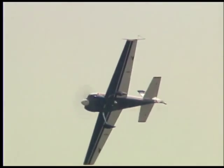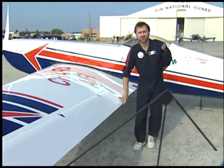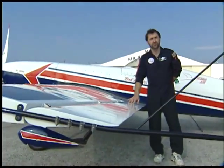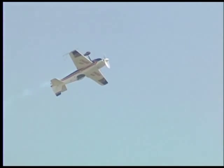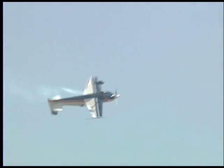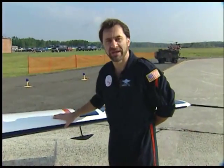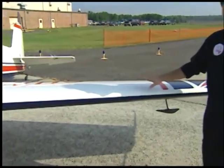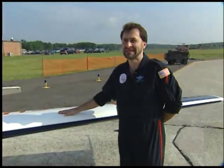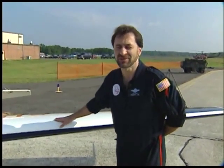The airplane has a wooden wing — wood from tip to tip. It's got a wooden spar with a plywood covering. The ailerons are what cause the airplane to roll. In my airplane, the ailerons are covered in fabric, so you can actually see there's a little bit of play, a little bit of give in the wing. The ailerons on this airplane give it a roll rate of about 360 degrees per second, so I can go from upright all the way around back to upright in one second.